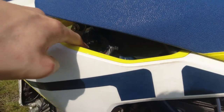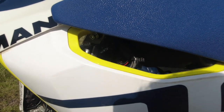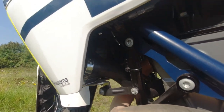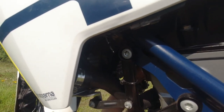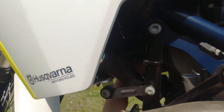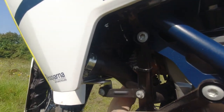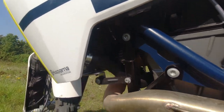Behind here there's the fan. Right now you can't see it exactly, but you have to cut out some piece of the fan bracket. You have to cut out the right edge of the fan bracket to make it fit, because otherwise you get into issues, or you will touch your ABS solenoid valve block, which is also over there. So nothing big, just cut it away with a multi-tool, and it's fine.